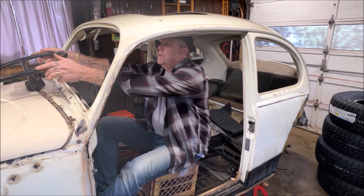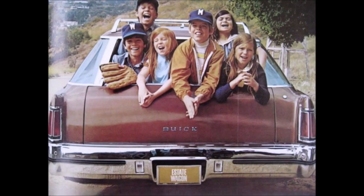You'll be able to go down the highway without wandering all over the place when you give it more caster, because that's what it needs. These were actually meant to be driven around cities — it was an economy car when it was made with that concept. I'm not saying they weren't built for the highways, but they weren't really. A lot of people in the '60s and '70s used it as a second car; they took their vans or larger cars when they did an outing.